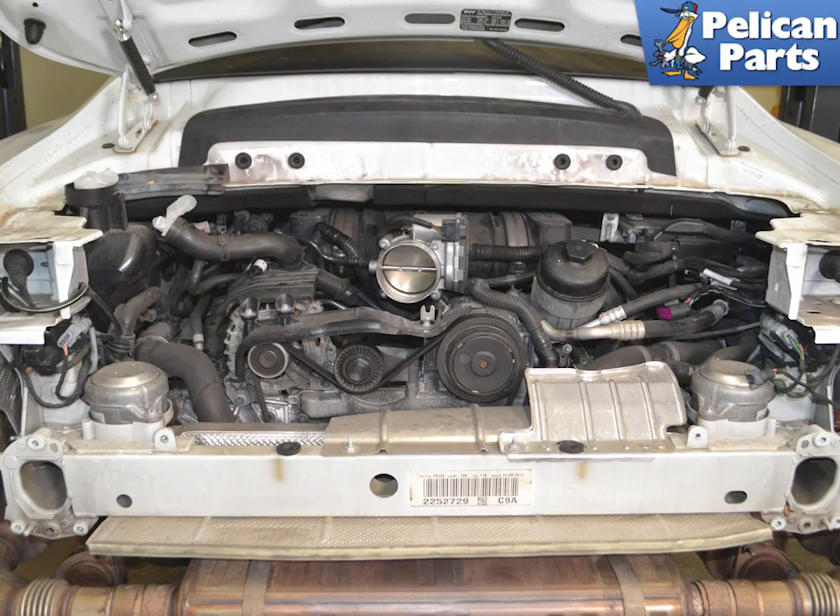To get to the oil cooler on your 991 Gen 1 you are going to have to move or remove a lot of components as well as drain and refill the cooling system. Some people will just pinch the coolant lines off but you are going to have an opening directly into the engine case, and I prefer to drain the coolant so there is no chance of contamination. Make sure that you order all of the gaskets and fluids necessary before you begin so as not to hold you up during reassembly.